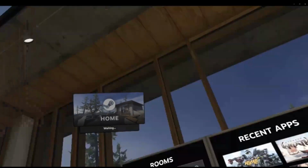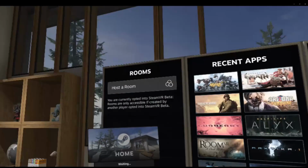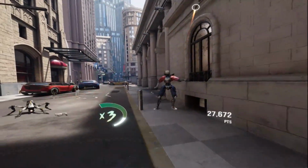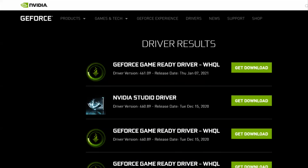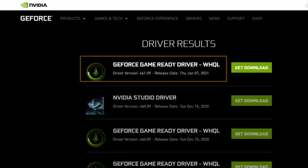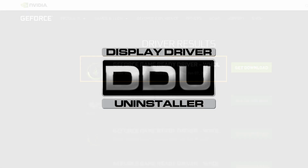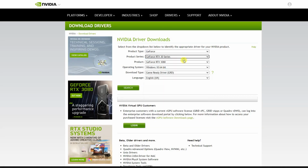The stutter you see here is the after result of playing Robo Recall. As far as playing Robo Recall went, the game ran perfectly well. If you only have the latest driver installed, you won't be able to do a rollback, so you'll need to uninstall it using DDU, link below, and find a lower version driver on NVIDIA's download page.